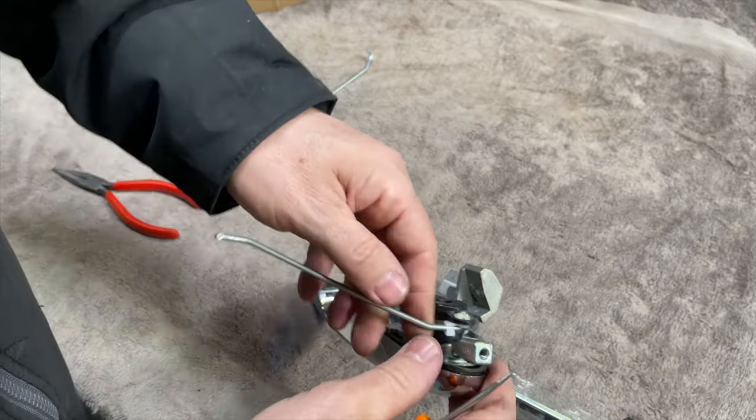Now we're going to swap the barrels over, so we'll peel back the shiny stuff, the protective cover. Right, and so this old one, to get the barrel out, what we're going to do is get the key in the barrel. So you turn that, this is upside down now, so from the upside down side, if you turn it, you can see there's a circlip there. So we'll turn that key, pop the screwdriver in and grab hold of that circlip there. I'll try to. There we go, look, out it comes. Pop that out. Out of there, like that.